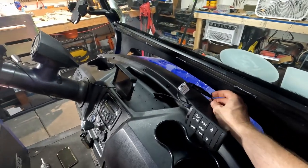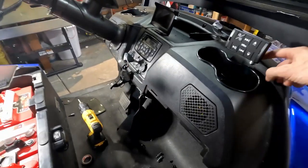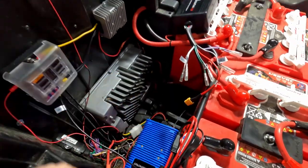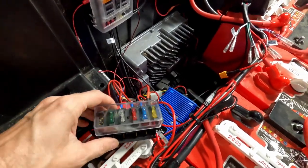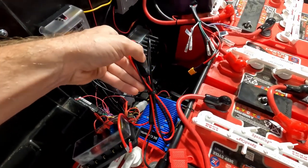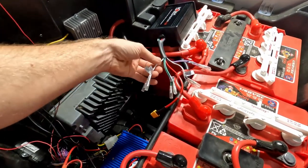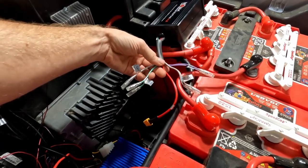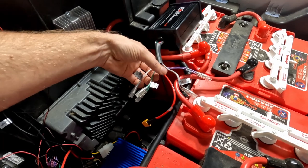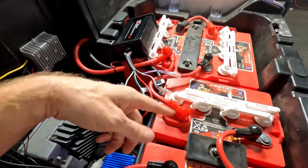Now I've got it wired up from underneath the dash. This is just a temporary setup, so we went ahead and affixed it to a screw that's already in the dash. Let's go ahead and get it powered up — I've already got my DC converter hooked up, going to my little fuse box right here, with the power wire run right here, and it already gets power. That's a pretty cool feature. For now I've got the left and right channels separated — the odds are right, evens are left. We've got channels one and three, two and four. Let's go ahead and hook up the speakers and get the wires run.